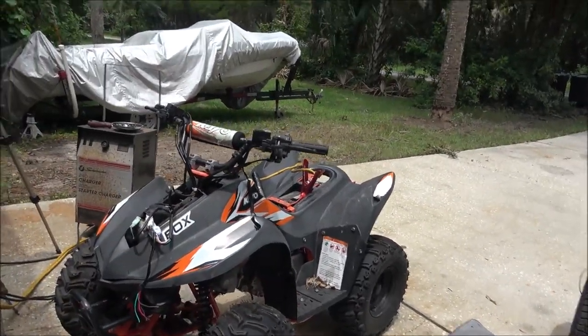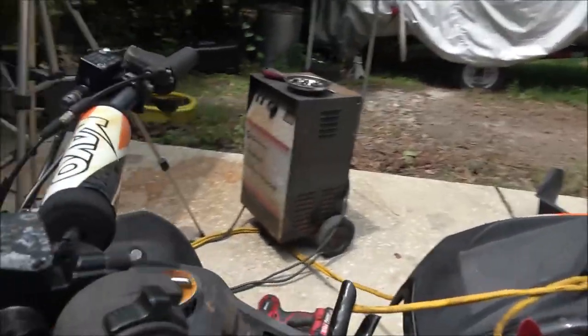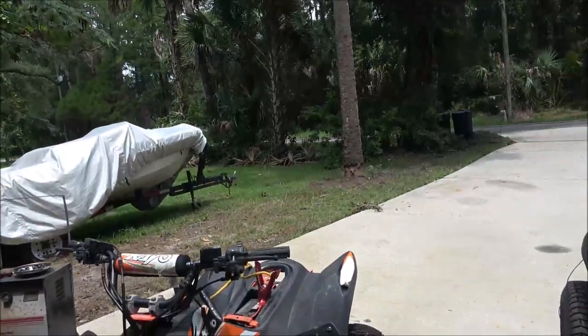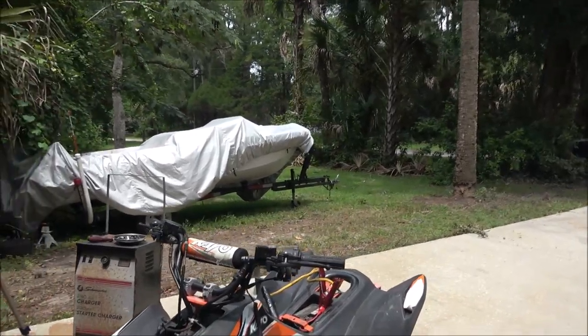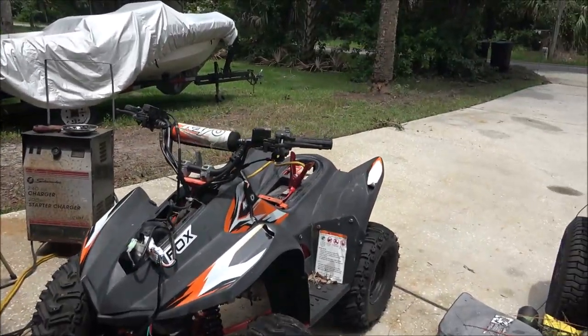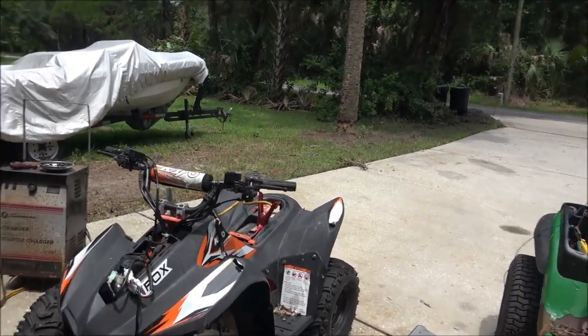And like I said, I'm pretty sure we're gonna have to get a carburetor, because this is the choke here and it's locked up. Here's the throttle, it's locked up. It could just be the cables, but seeing as how that's still got fuel in it, I doubt it. But we'll see. I'm putting a budget of $100 on this thing, because I know I can make money at $100. I know I can double my money, so I just got to be careful.